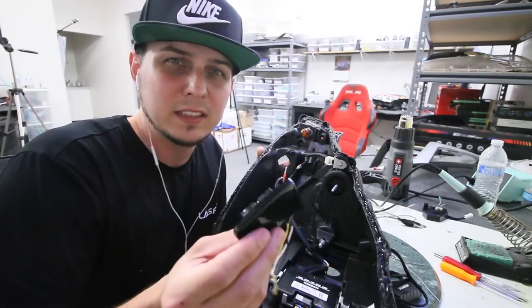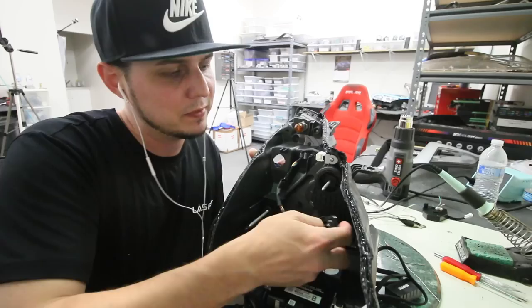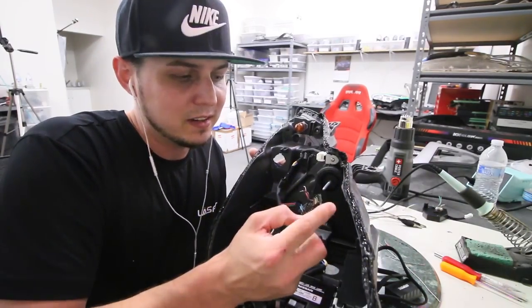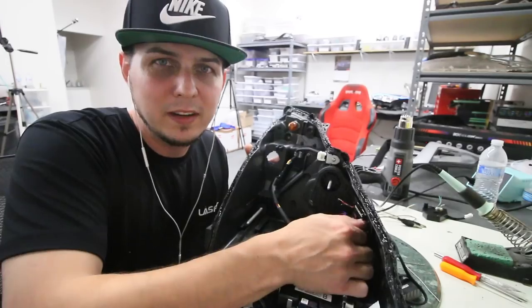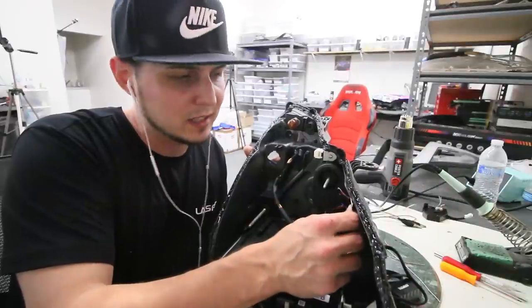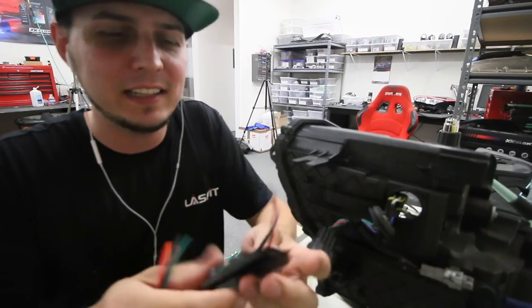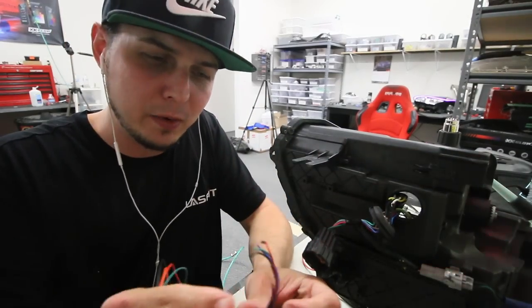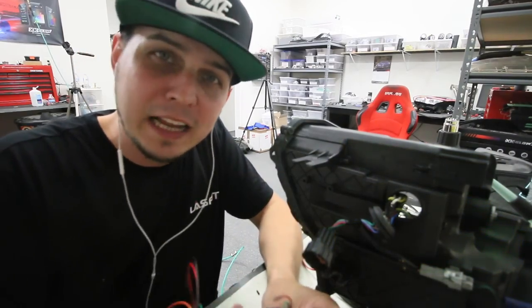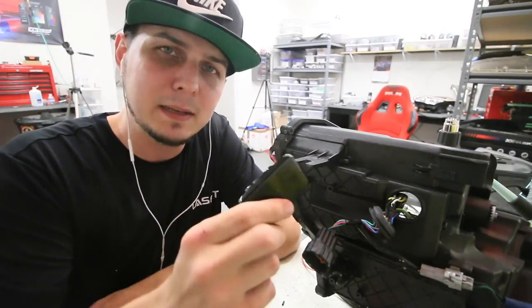Most cases it's going to be a headlight that has dust caps, so all you have to do is take the back cap off, access the module, plug into it, reprogram it, do whatever you want. But in this case with the GTR I want it mounted right around here — the wires coming from this little grommet are going to perfectly reach this without too much excess. Everything has to line up just perfect for the GTR build. To get this ghost module ready I need to extend the power to the LEDs, plus the ground input, power input, turn signal, show mode 1, and show mode 2 — six wires total, basically hardwired so this guy is in place and ready.